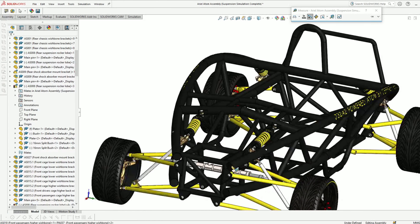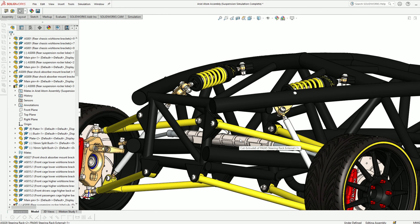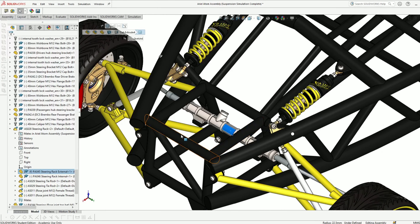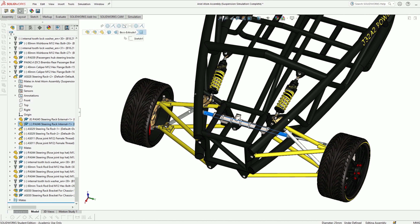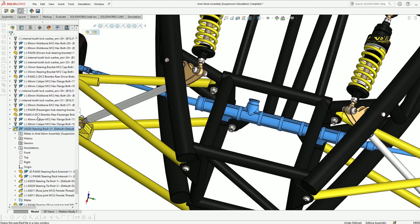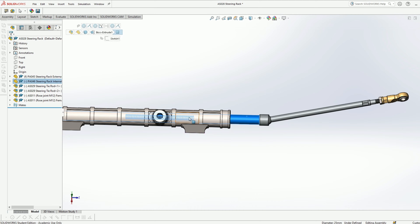Steering was only done very recently — the steering rack didn't exist about two months ago. I started drawing it and only finished it a couple of weeks ago, and had a lot of issues with the animation. This steering rack is mocked up for this car. The travel in it is 140 millimeters — 70 millimeters out each way — and that allows the steering to do a full cut of approximately 40 to 45 degrees. I'll simulate that at the end. For now I'm opening this power steering rack to show exactly what's in it — you can see the little teeth I've drawn on there.